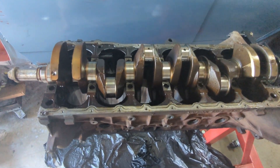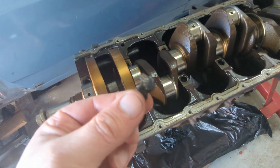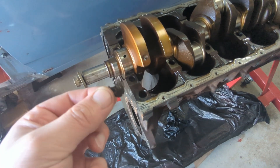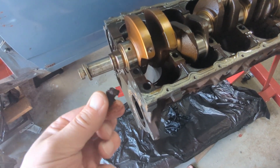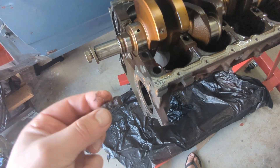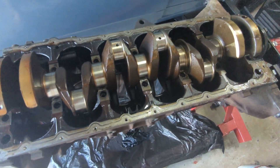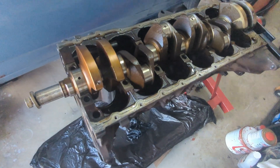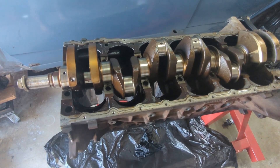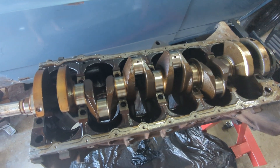So we've got the sump off, pulled the main caps off and the windage tray that bolts to the caps. This fell out as soon as I turned the motor over — and this wasn't the only thing that fell out. There were quite a lot of pieces like this. The tip that Uncle Tony gave about scraping the cylinders from the water jackets actually does work, so definitely do that. Overall it's looking pretty good. The crank does look very nice and clean. However, I will still send it to Dandy Engines to get checked for straightness and probably just a quick skim on the journals. I'm keen to run standard size bearings and I think it will come up okay after a quick skim on the linisher.